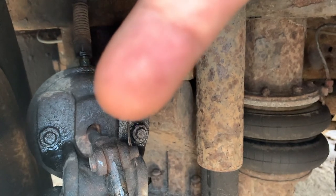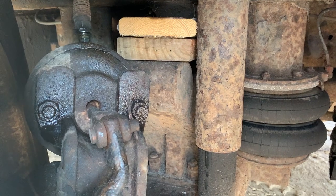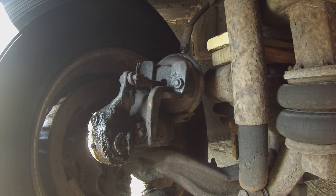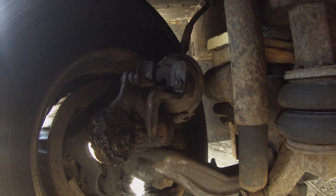Basically what's happening is there's a leak here. I think I've got some brake air pressure left — I'll show you real quick with the GoPro. You could probably hear that, and you probably didn't see that pin move all that much. So there's definitely a leaking diaphragm there. We're going to pull that can out and take a look at it, hoping to replace it.